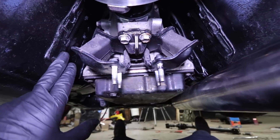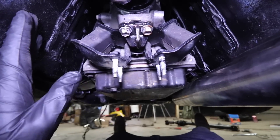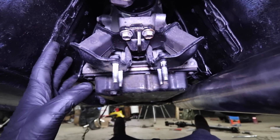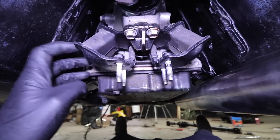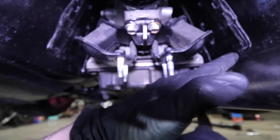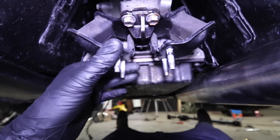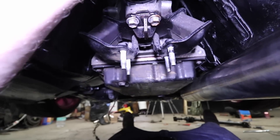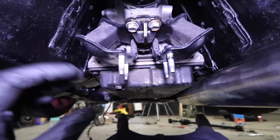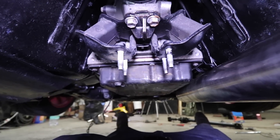What we're going to do is build some L-brackets that bolt into the side of the car. I may weld them in, but I'm worried — with nobody else in the shop, if I weld here and get it too hot I could catch the interior on fire and not even know it. Some kits I've looked at online bolt into the side, so for now I'm thinking bolts. An L-bracket comes off each side, we run a straight plate across, and it bolts up to the four-bolt pattern on the transmission mount. We'll mock up the L-brackets with cardboard, cut them out of metal, and work from there.